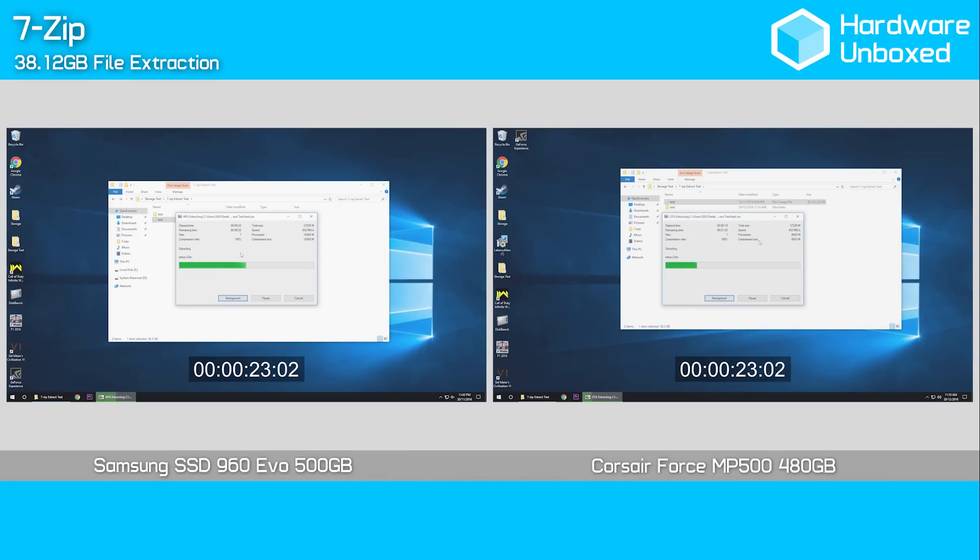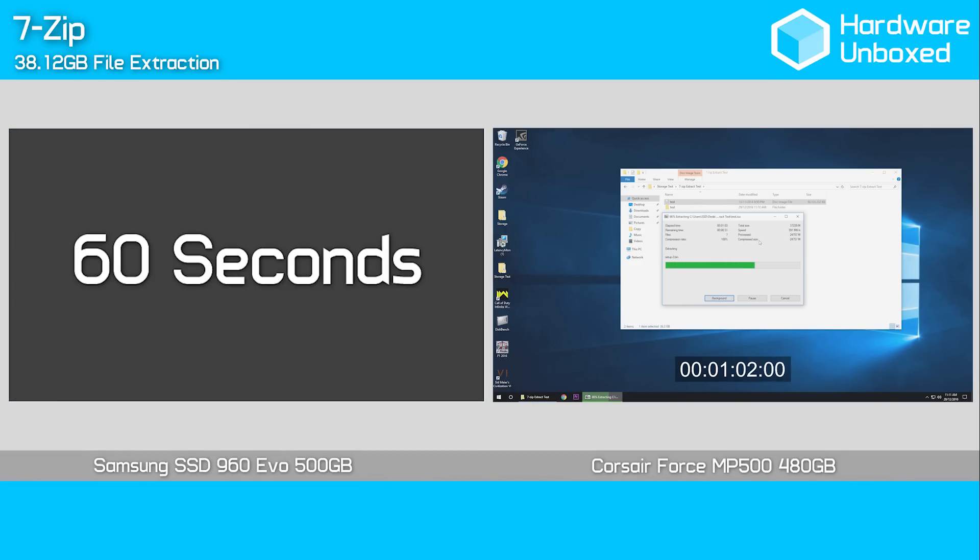However, when we start to turn up the heat with some heavy write traffic, the MP500 does start to lag behind the competition — as seen previously in the file copy tests. Small writes also seem to be a bit of an issue, and this is something Phison controllers have struggled with in the past. The 960 Evo is able to blast through the 7-zip test thanks to a throughput of 660MB per second, though that still makes it rather slow compared to the 960 Pro's almost 1GB per second sustained throughput. The MP500 took just over a minute and a half to complete the test due to a limited 383MB per second throughput. Granted, that hardly makes it slow, but it's well under half the performance of Samsung's 960 Pro — so it looks like Corsair really needs to be more aggressive with their pricing, though I do believe the margins are already very slim here.